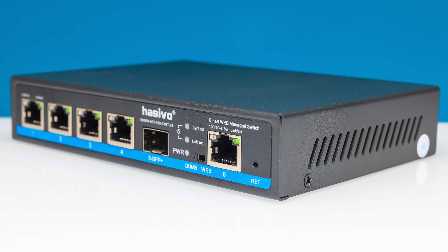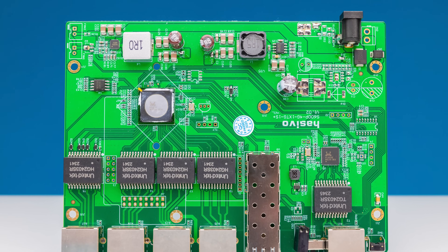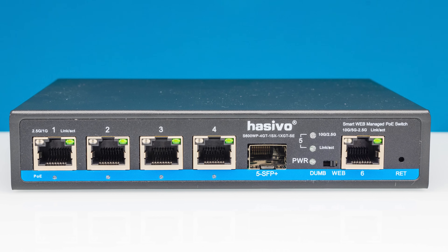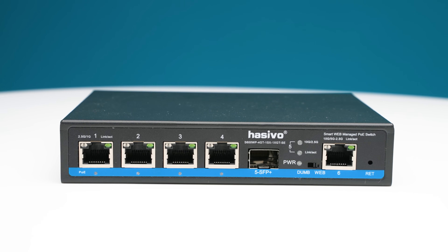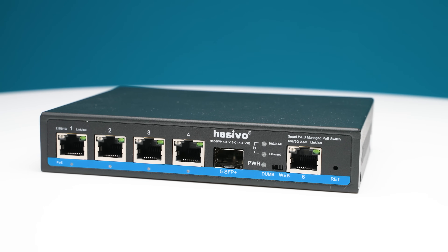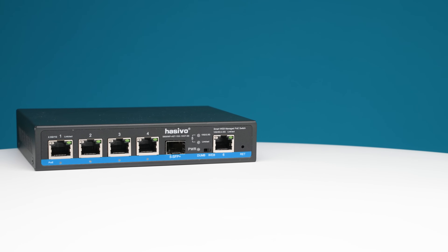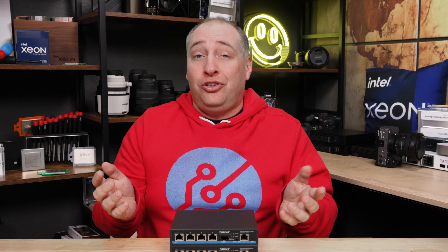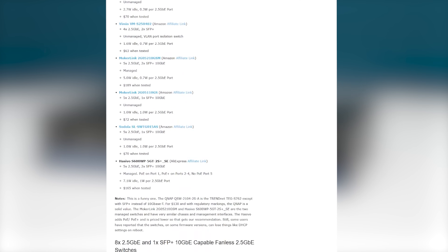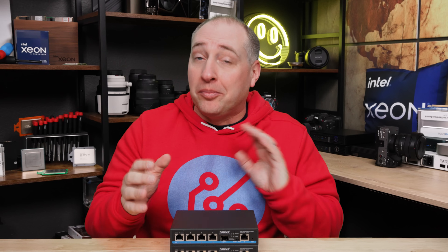A lot of folks are going to ask what something like this is for. I think of it as: you have a little apartment, a hot dog stand, something like that. You can have a couple PoE ports for cameras, plus connectivity to a NAS and a desktop at pretty high speeds, and then you can put a 1 gig cable connection on one of the 2.5 gig ethernet ports and you're all set. If you need higher port counts, we have stuff coming for you — just hold on. But if you just need a small, relatively inexpensive, fanless, quiet unit that doesn't use a lot of power, this has a lot going for it. We'll link to our full switch guide in the description, and stay tuned for more 2.5 gig ethernet videos coming soon.